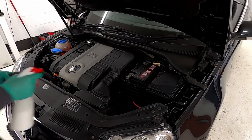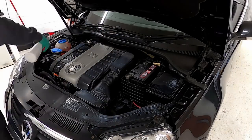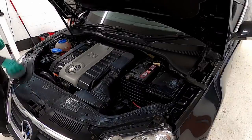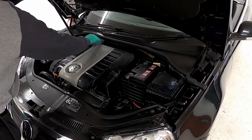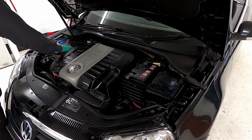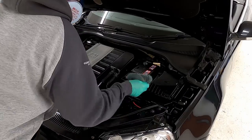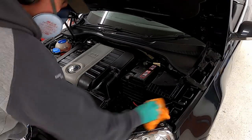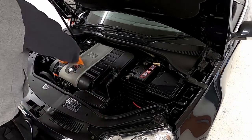This is another new product to me as well - it's called CarPro Pearl and it can be diluted down 50/50, product to water. I'm using one of those little mitts to spray it all over the plastics and trims and rub it in, then buff off any residue with a nice clean cloth. A little tip I like about these mitts is they've got a little pocket on the back you put your hand in, and they almost perfectly stretch over the top of the trigger spray bottle. I might have three or four different products and they've all got their own little mitt on it because you can use them over and over again once the product's impregnated into it. It just saves wastage - it's a really good idea.